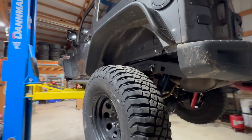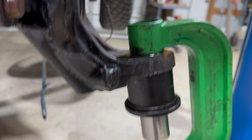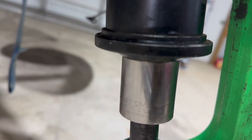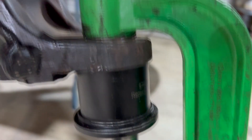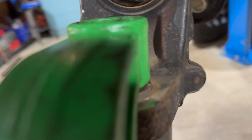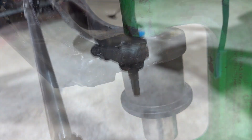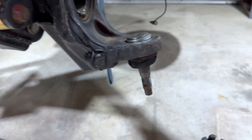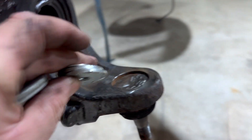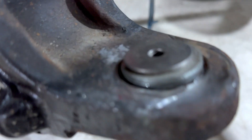Here's the setup — I don't know if it's going to work yet. I've already had a lot of failed attempts. I've got a socket, one of the adapters, the receiver cup, and the clamp. From all the failed attempts I've ground off the mushroomed-over edge on top of the ball joint. I don't have the right insert to go down in there, so I'm having to stack washers each time the tool bottoms out. Right now I'm at four washers thick.